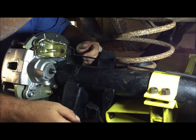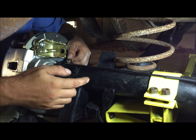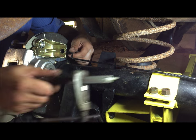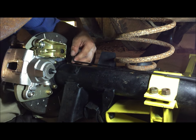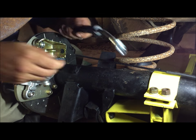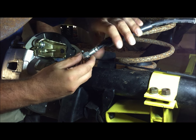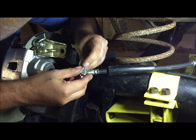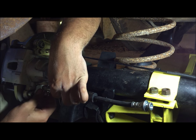Blow these lines out and make sure they are not clogged, because they will be clogged. This is part two — 70 Chevelle rear disc brakes, Eldorado calipers — now we're going over the e-brake and a starting point for the rear brake lines. You're gonna need a flaring tool. We'll start by mocking it up to give you an idea. Get your brake hose on there first — make sure you put it on correctly. Get a feel of the floppiness; it's going to go down to up.